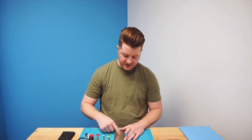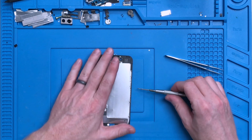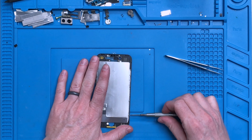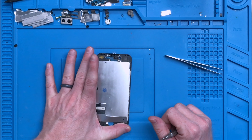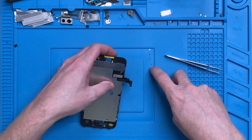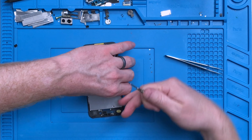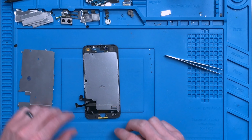Moving down the device, you'll see the metal bracket or mid plate that covers the backlight. If we pull this off, we can reveal the flexes underneath. During repair there's really no reason to pull this off, but I'm doing it here for demonstration purposes. As I'm pulling these screws out, the only place I'm putting any pressure is the bezel itself. You want to ensure you're not putting any undue pressure on the actual back of the LCD. I'm holding it on the bottom part of the bezel and also on the top, ensuring I'm not pushing on any corners of the LCD. The LCD on iPhones is glass — very easy to damage if you push too hard — so we want to put our hands where we won't cause damage to the new parts. All these side screws are identical in length. Lifting off the back bracket carefully, we can see the two flexes underneath.